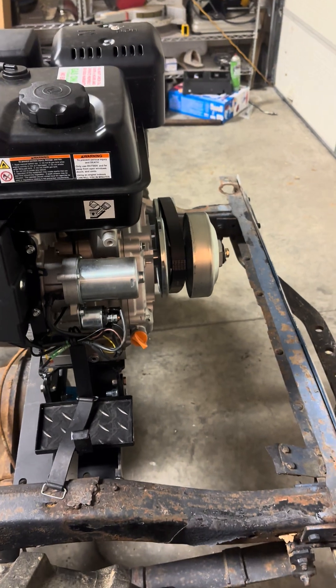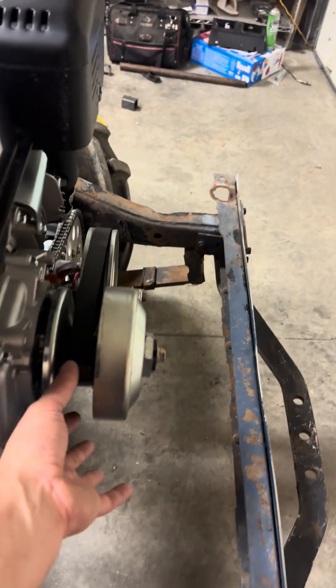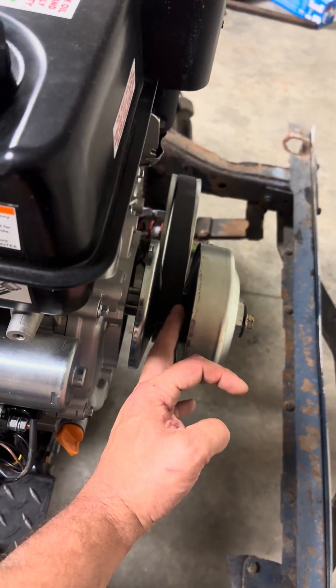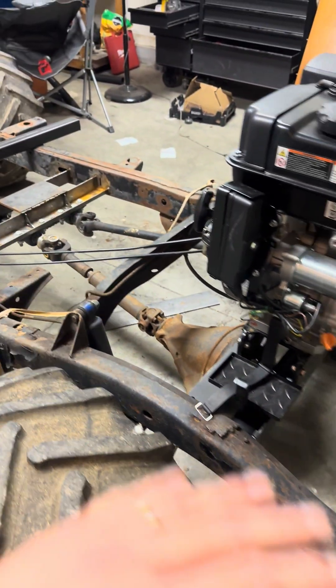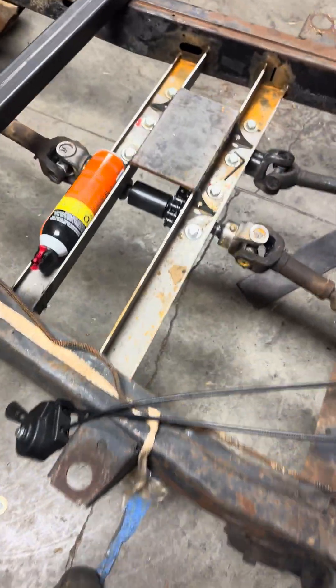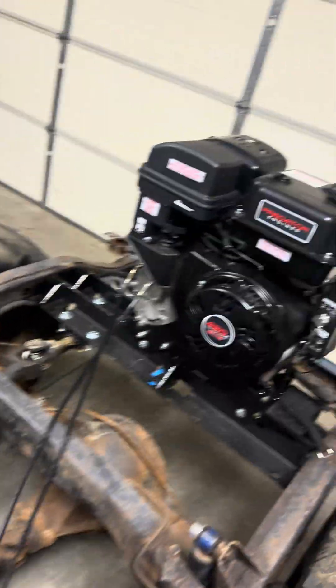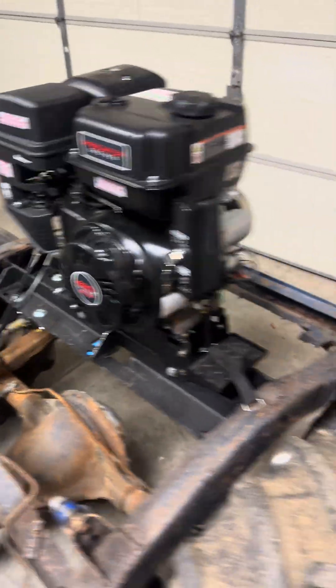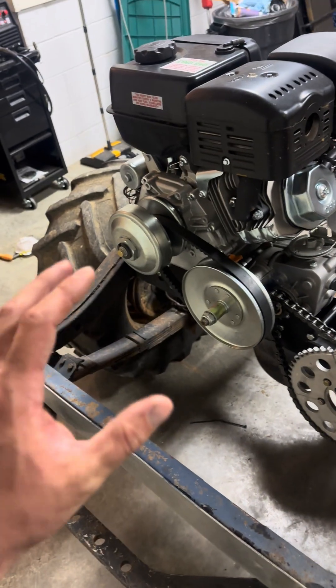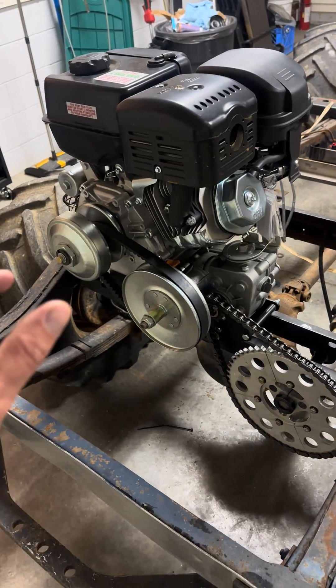Otherwise it's 1600 RPM, and the only issue with that is at 1600 on the factory one, this would already start to engage. Based off the old videos y'all have seen, it would start to jerk and creep up and creep back, so it was never really in neutral - and that would create a massive clunk and binding when trying to shift back for the reverse gearbox. Once you upgrade the springs and leave just the factory weights in, it allows it to engage with no problem at all.